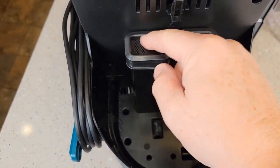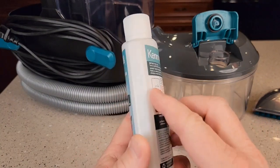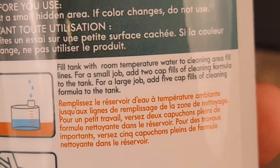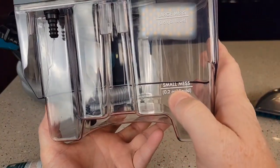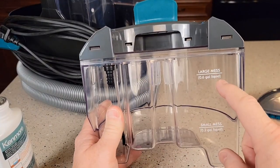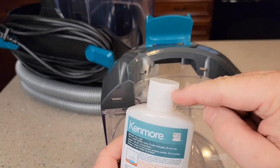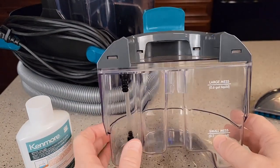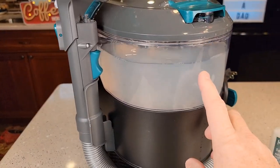Sometimes you might have to clean some hair off of this little screen on the dirty water side. So we're going to fill up the solution tank. This solution that comes with it is concentrated. The directions say for small jobs, two capfuls, and for large jobs, five capfuls. That cap holds one tablespoon or a half an ounce. So if you've got another type of solution, you're going to put one ounce for a small job or about two and a half to three ounces for a large mess. Add water first — if you put your solution in first and then add water, it could bubble up and over.